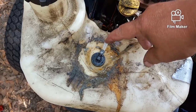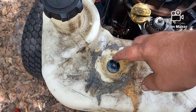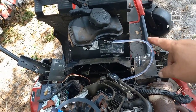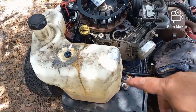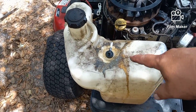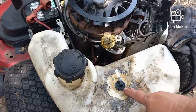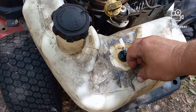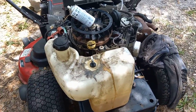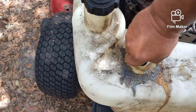What happens is when that goes down into that hole, the hole is a little smaller than the fitting. It expands in the hole and seals it around the hole of the tank and you're good. You can still turn it if you want to. This piece right here is what they had half-assed for a fuel line — that just needs to come off and the new fuel line will go on to the fuel pump. Now I have a fuel pickup that goes all the way to the bottom of the tank and it will connect to the fuel pump. Our fuel tank is fixed. All that sealant they used — dried out, crapping up, and coming off — was all unnecessary. The rubber bushing was about $2.20 and the problem is fixed. Just that simple. Strong, ready to rock.